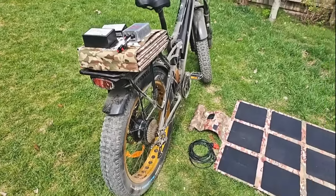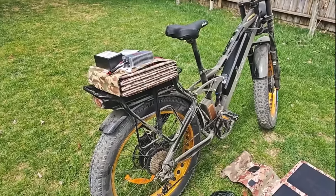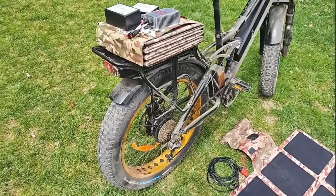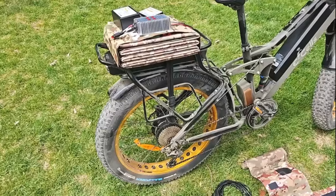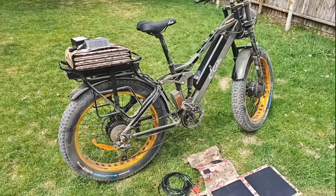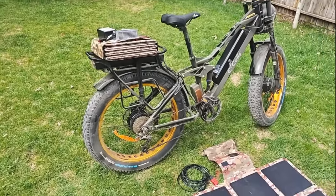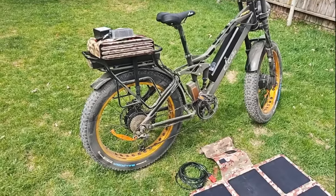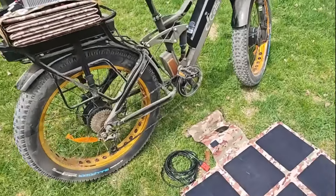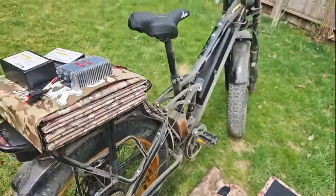The only thing to be aware of at this point is there's no cookie-cutter e-bike battery connector out there — there are several different connectors available. We might not have the exact connector for your bike, so worst case you'll need to buy an additional charger from your e-bike company, then cut off the end and have someone with basic electrical knowledge wire in Anderson Power Pole connectors — that's what we use because they're pretty common and it's not that difficult to do.